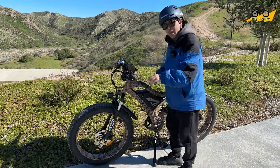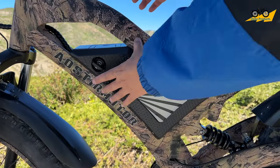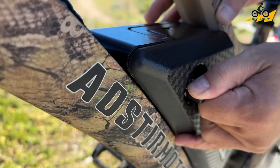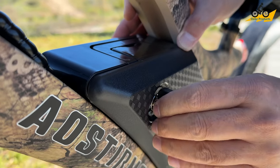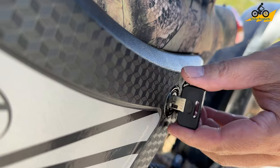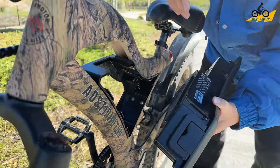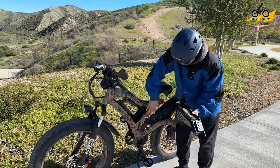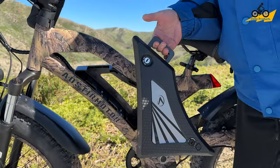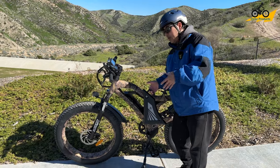The design is not that heavy considering its size, though it is heavy because of the 1500 watt motor in the back. Where they did save on weight is with a 15 amp hour battery — this battery is only about the size of my hand. The frame integrates it nicely so it doesn't look bulky. They do say it has about a 20 mile range, and I think that's going to be pretty accurate — somewhere between 20 to 35 miles depending on conditions.